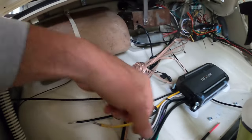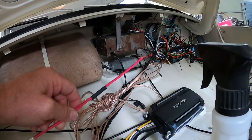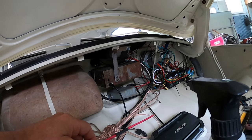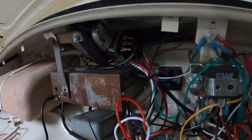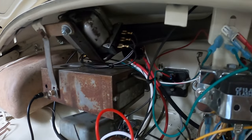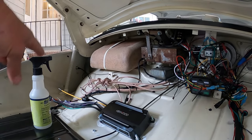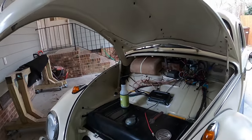The question is whether I should run a whole separate wire to the battery from this amp, or split off of my ignition's always-hot wire. That looks like a 10-gauge wire. I can test some of the other wires to see which one comes straight from the battery — maybe the headlight wire, which looks like an even thicker gauge. I'm trying to avoid running a whole new wire from the battery under the carpet up through the hole to connect to the yellow wire.